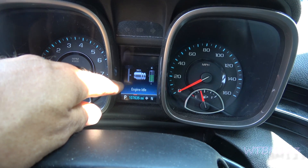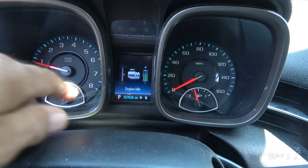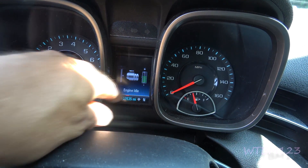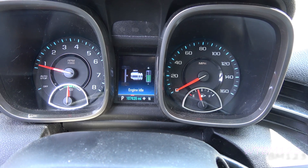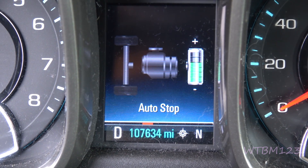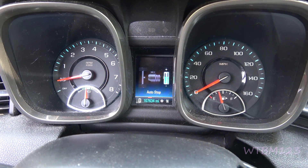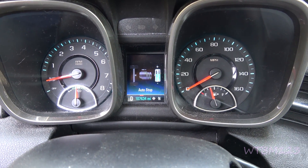As you're driving, it would switch back from engine power to battery charge to engine idle — it said everything correctly. That's what made me think the drive motor is probably working okay, but it just wasn't going back to charge the batteries. I think the DTCs had it locked out. The auto-stop is working too — once the battery started getting charged up again in the back, the auto-stop started working. So if you have any of these problems after that bracket breakage, resetting everything might be the way to go instead of replacing everything.